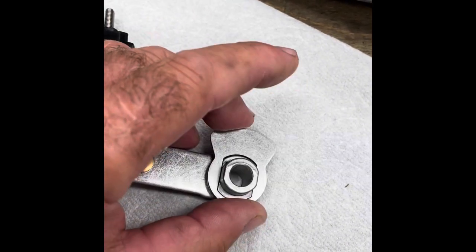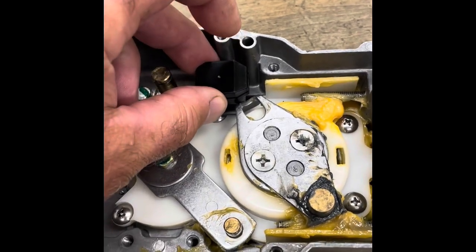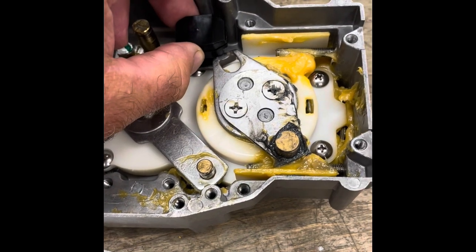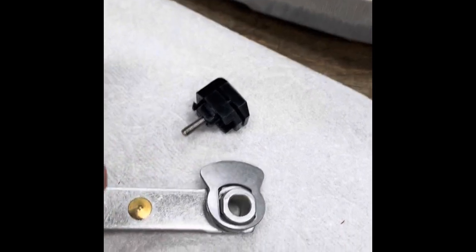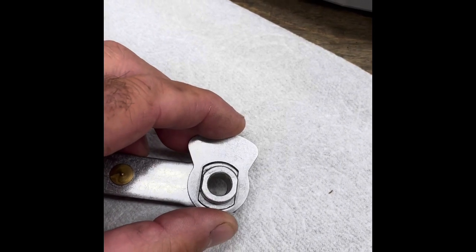Additionally, it's not just this piece that's sloppy. It's this piece which fits in that. You can see this has that shape right there around the screw with a little kind of a clip thing on the back that fits in there, which isn't supposed to move at all because this is what's holding onto that plate. There's a tiny bit of slop in this as well. So when you move the throttle lever, which is moving this arm, you are getting two different things that each have a little slop. When you add that together, you have a lot of slop — about 200 RPM. You might be experiencing 50, you might be experiencing 300 RPM. This piece, by the way, is the primary reason why it's doing it.